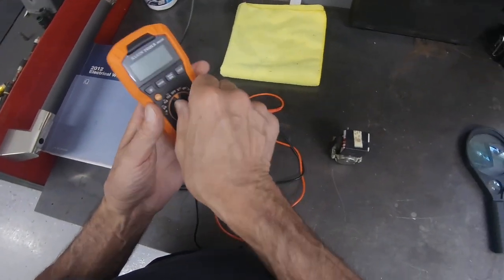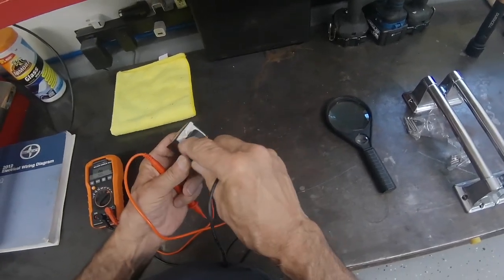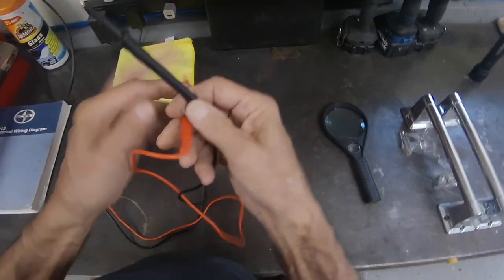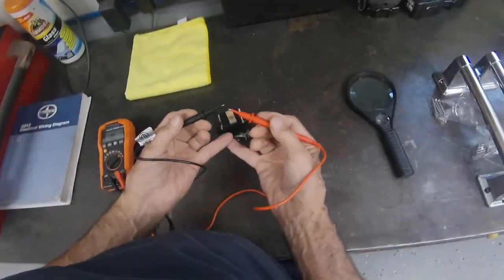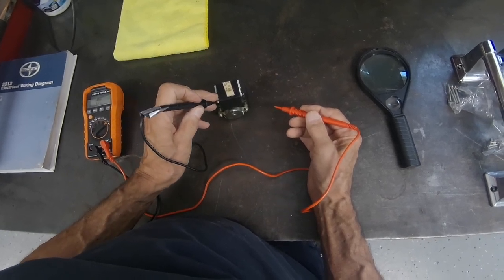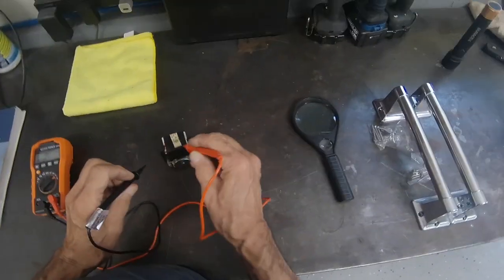How do I know the motor was bad? Well, we can check. Here is the red wire that goes into this coil, and here is the white. We should have continuity — we put this right in there so it touches the copper wire for the red line, and now I'm touching the white. And there's no continuity. It means there's an open circuit in here somewhere. This is a really rare incident that I find.